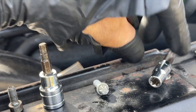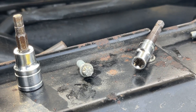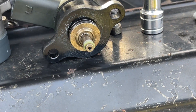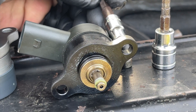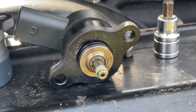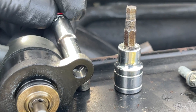It's an E8. My E8 socket, even my smallest one, flares out right away, and there is no room to get at that second bolt. As it sits on the back of the rail, I can get to this bolt without any problem — it's blind, I've got a feel for it, but I can get to it. Over here there isn't enough room between this housing and the intake manifold. But what I've found works: a quarter-inch drive deep socket, quarter-inch socket. Reaches in there just past that guy.